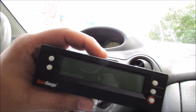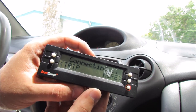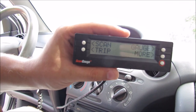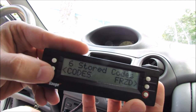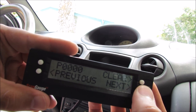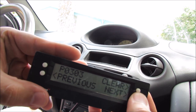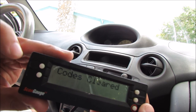I'm going to start the car up. And there we go, connecting. We can tell already that we have the check engine light going on in the upper right hand corner there. So let's run the scan on this — all you have to do is hit the scan button. Six stored codes. We'll check the codes. We've got P0303, P0304, P0440. We can go through the previous ones but that seems to be it. Another advantage of this is that you can clear the codes, so you say yes — all the codes are cleared.